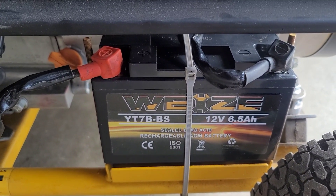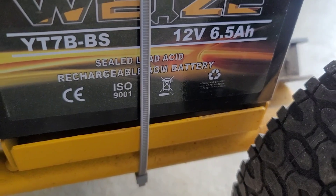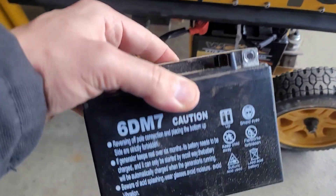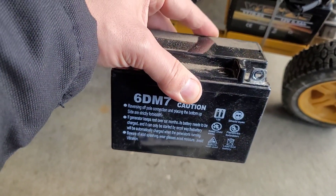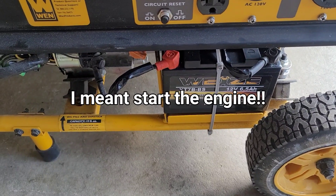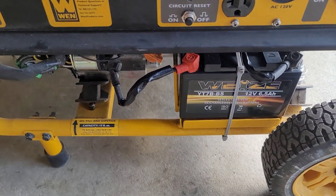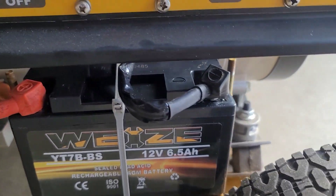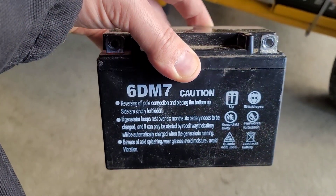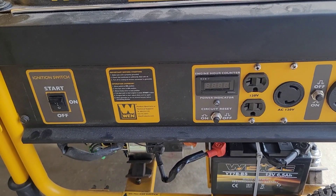On the starter battery, I did install a YT7B-BS, which is a six and a half amp hour battery, but as you can see it doesn't exactly fit inside the battery tray. The original one was a 6DM7, which is just a little bit shorter than that. Maybe you guys can help me out because I do not know what other battery could possibly fit. You might be able to go to a 5 amp hour or a 4 amp hour — it really is just there to start the engine, but I didn't want to go too small for fear that he might not have enough juice to crank it. I just put a zip tie here instead of using the lockdown wing nuts and the plate. I've heard a lot of bad reviews about this particular battery, and given that this machine has almost no time on it, it was obviously not used very much and wasn't maintained, and this battery has been known to fail very quickly.